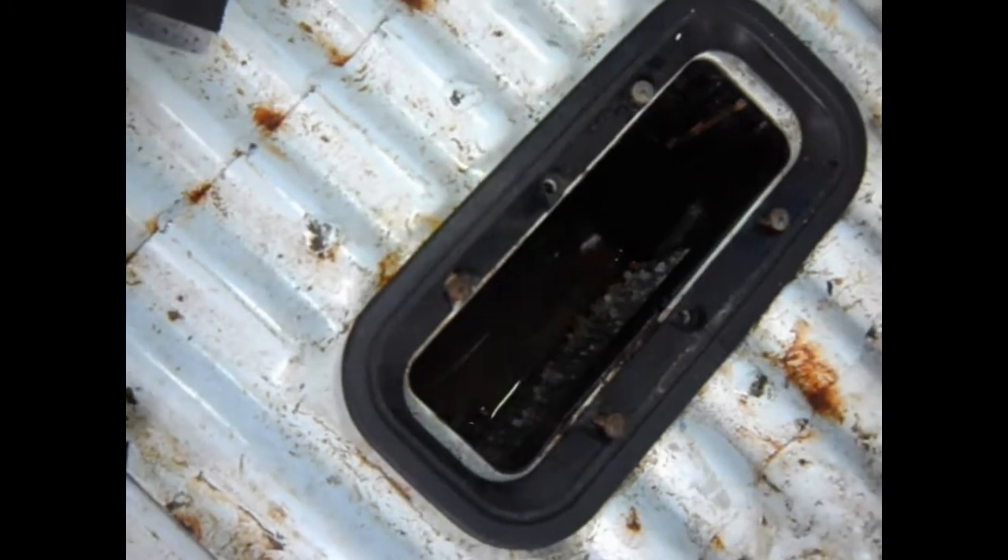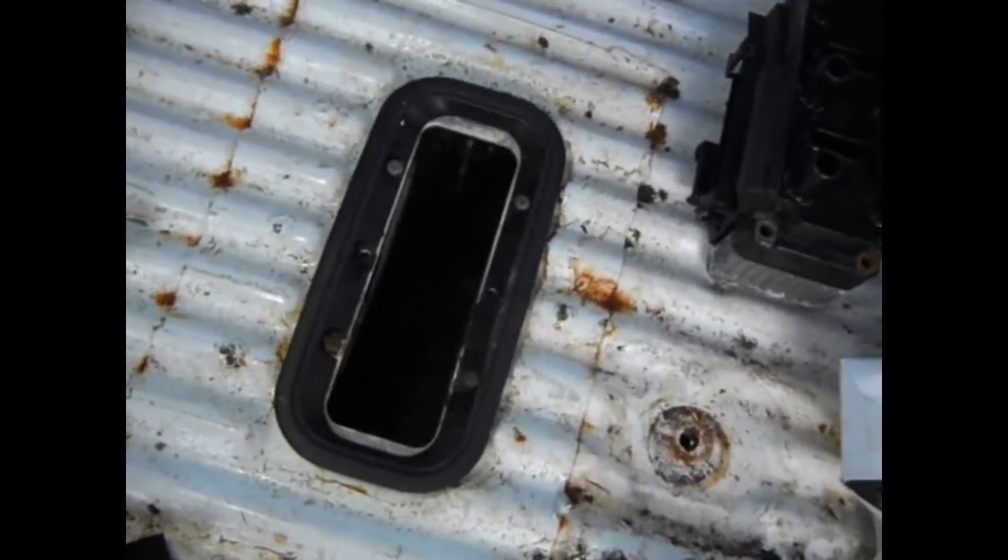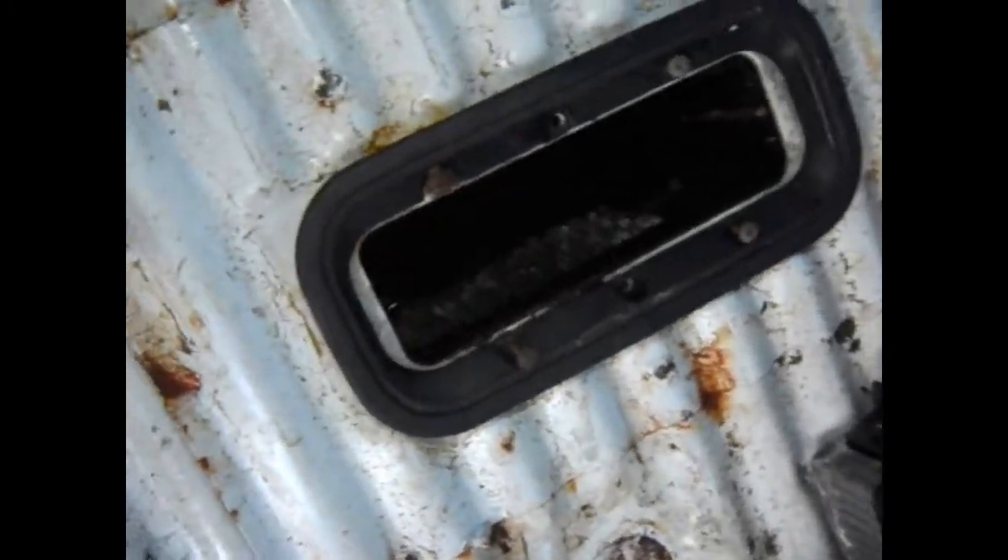I had been wondering if it was damp coming in from some leak or other, finding its way through the carpet, but with that level of corrosion and whatnot, it's clearly coming from the heater matrix. So I've got a new one which I'm going to fit, and I've already drained the coolant out.